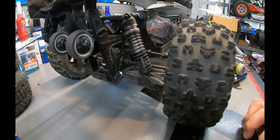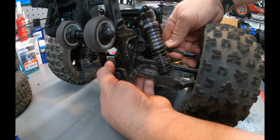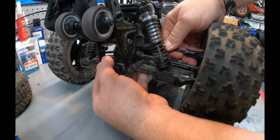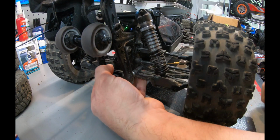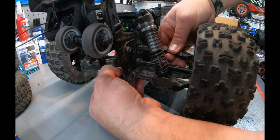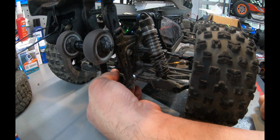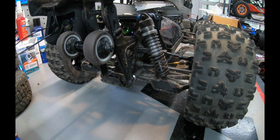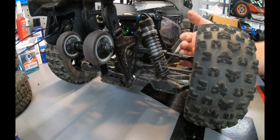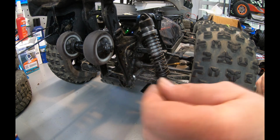Now this is where suspension can be changed. Was I upper hole? I think I was upper hole. It was actually in the bottom hole. So in the bottom hole, what does that do? That will tip the tire in. In the top hole, I'm going to go with top hole placement, because the top hole under squat is going to keep the tire more flat, I believe.